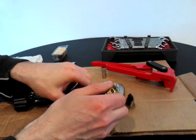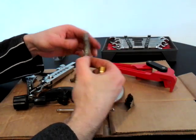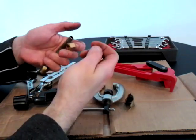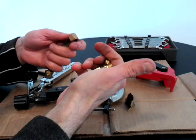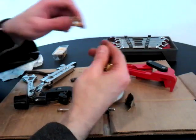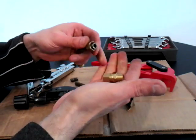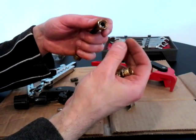Here's a real example: I had a '91 Lumina, changed the fuel filter underneath, primed the pump, and gas was leaking from on top of the gas tank. I cut the line, made a repair using a compression fitting, then primed it again with the tank down to check for leaks. To prevent the headache of it leaking again, I went around the whole compression union with JB Weld to make sure it would never leak — worth doing if it's somewhere hard to reach.